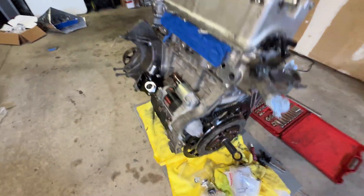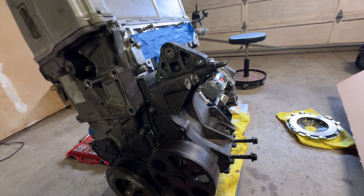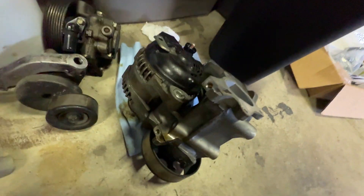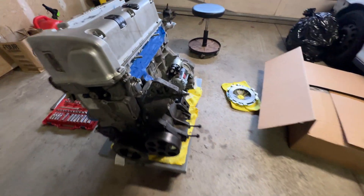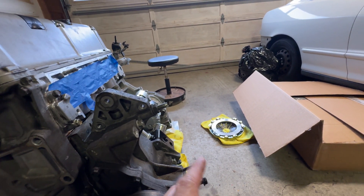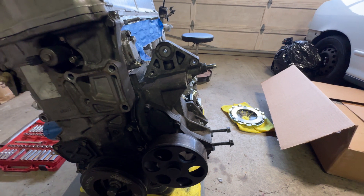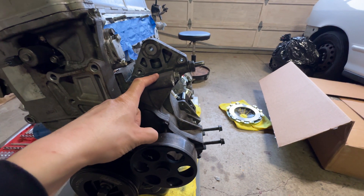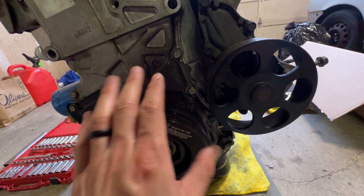Some other things we've done to the motor: we switched out the JDM water pump housing for a USDM unit. The reason we did this is because the mountings for the alternator and tensioner are all different compared to the USDM one — the shape is entirely different. So if the alternator ever went bad you'd have to find a JDM alternator, which would be a pain. Since USDM stuff is more readily available, we swapped to the USDM housing. We also put a fluid damper on because we had one laying around and figured it would improve the motor's acceleration smoothness.